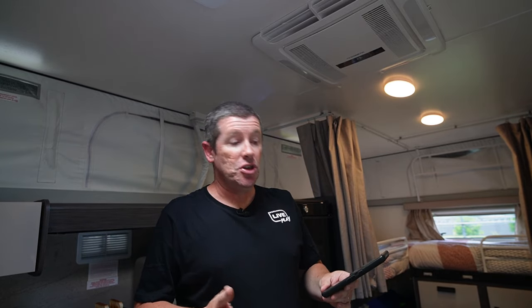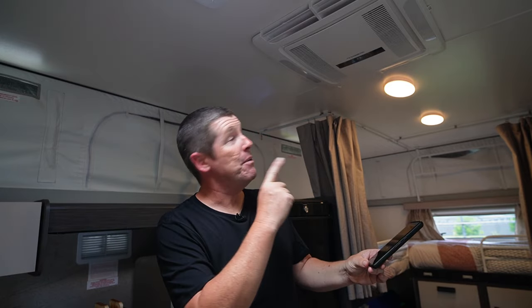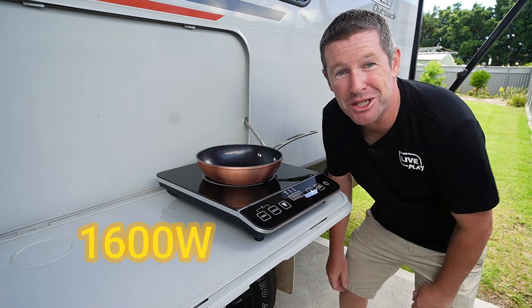I was interested to see if it would run the caravan air conditioner. We currently had around 49 watts being consumed by the caravan itself. On cool at 23 degrees, it went into startup at 310 watts and then settled in at around 685 watts — just under 700 watts. At that usage you could expect around two and a half hours of use, or with around 700 watts of solar input during the day you might achieve a neutral draw. It will run the AC no problems, but you don't want to run it for too long as you'll draw the battery down really quickly.